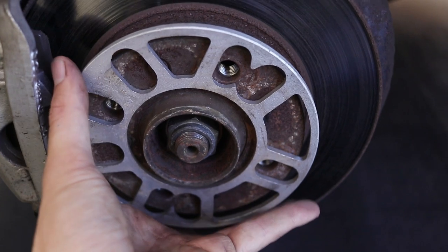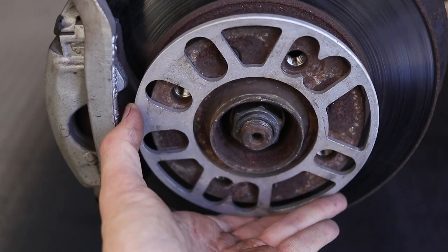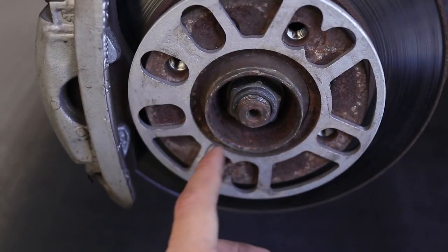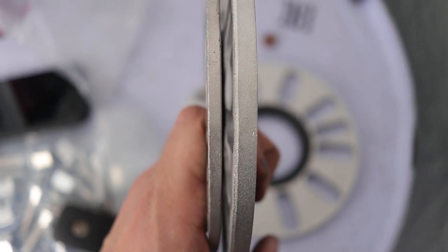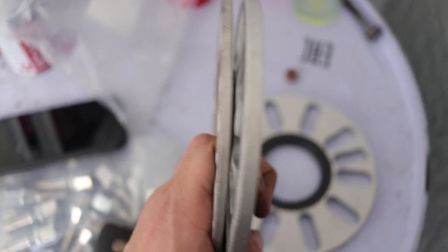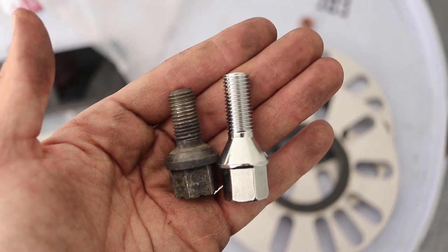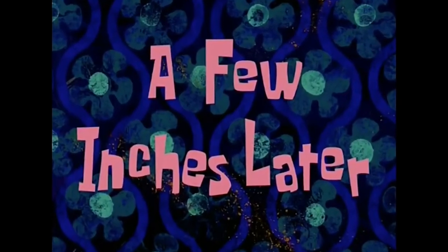As you can see, there's no spigot on here so there's a lot of play and it's very loose — we think that could have been the cause of the vibration. I'm going to put the spigot in so it can be centralized properly. You can see the difference in size: the one on the left is the front 5mm and the one on the right is the 8mm for the rear. You can also see the difference in the bolt sizes to compensate for the 8mm. Unfortunately we ran into a bit of an issue — things don't always go according to plan, and that's part of the game.